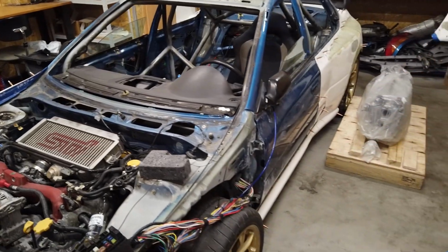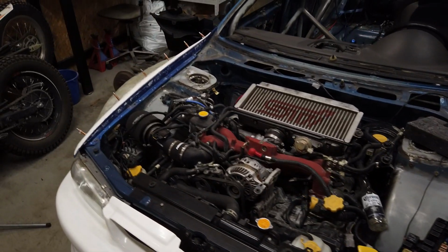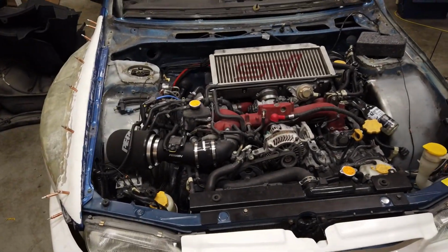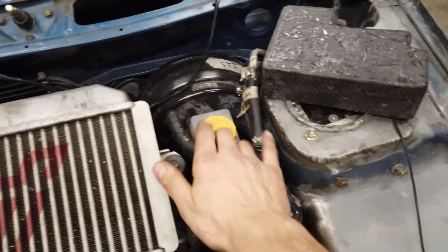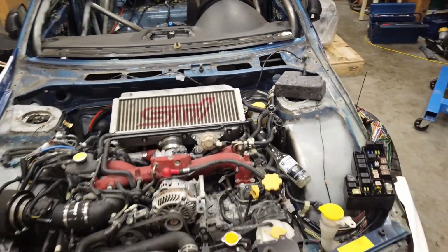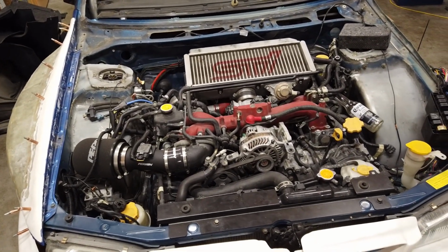I've also checked all of my fuses in here and under the dash as well, so I know those are good to go. There's no issue there. And I've also tried to check all of my grounds, made sure they're connected to clean metal for good connections. And I've even put brake fluid inside of here because there's a sensor. I thought that could trigger some ABS stuff. But yeah, I've tried a bunch of stuff and I don't know what else it could be.